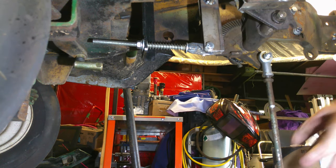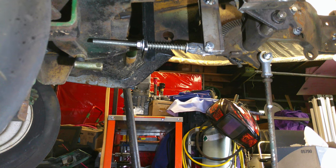What we'll probably do is I'll get the oxyacetylene torch out, put that piece in the vise, heat it up, bend it some, come over, fit it on the tractor, see how it looks, and we'll go from there. Or maybe I'll just grab a piece of cardboard and draw a rough line of where I want it, and then heat it up, bend it, and see how close we are. So, all right, I'm going to do that off camera. Y'all probably seen hundreds of people heat stuff up and bend it. Doesn't make real good video, so let me get that done, and then we'll come back.